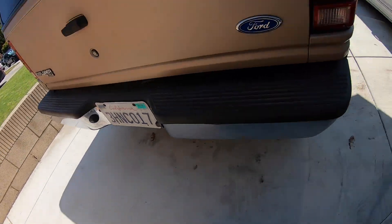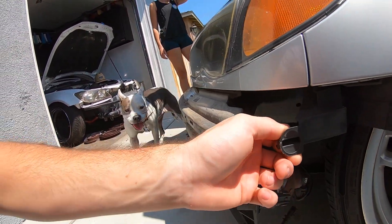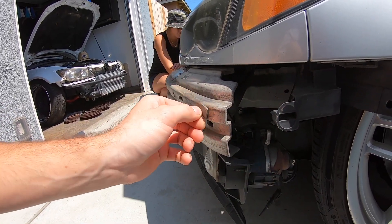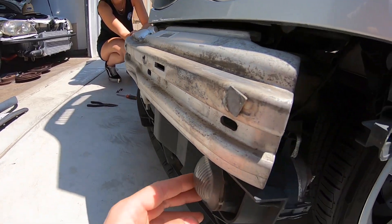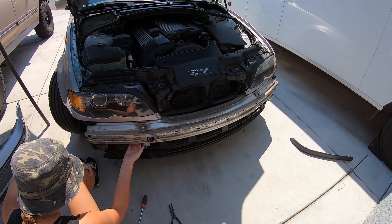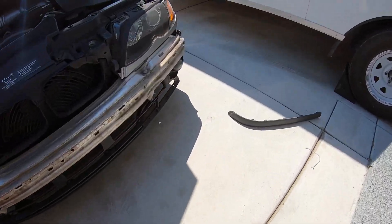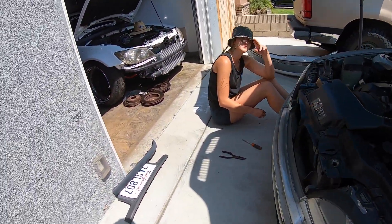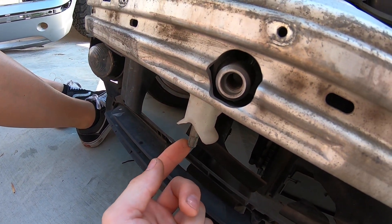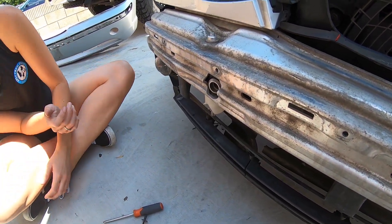There are little slidey brackets on both sides with clips - this one is broken but this one is still intact. It's a little different because it's thinner. Now we have to pull off the fog light assembly - there are more push clips on the bottom of the crash bar. Unplug the fog lights. Someone did some sketchy stuff over here - looks like someone tied it with bail wire. If you wanted to take off the crash bar, you undo a Torx bolt, but we're not removing the crash bar because we can use it with the M3 bumper.